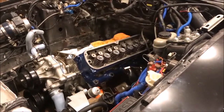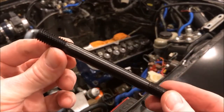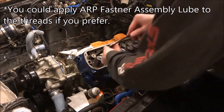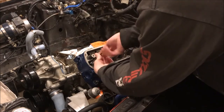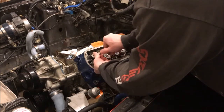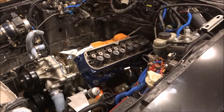Don't go thinking you need to torque the studs — we've got an 11/32 Allen key and we're just hand-tightening. You do not want to torque those down at all. We've got all the lower studs in; now we just need to get the longer upper ones in. We don't need to apply anything to these — just spin them on. Remember: do not torque the studs, hand-tight only. Just make sure they're seated.